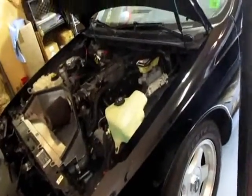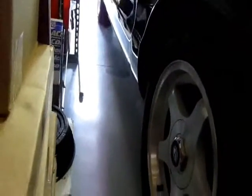So I think the PWM has to go. Gotta drop the pan and put a spring in place of it. If anyone's done it, let me know. It looks pretty easy. I don't think I even have to drop the valve body; I can do it on the car. And I could drop the boost valve too — put a better boost valve in and the pump.